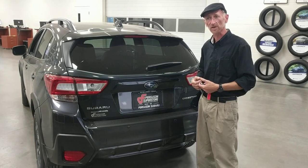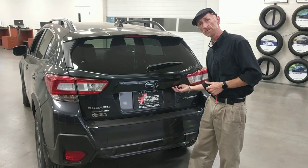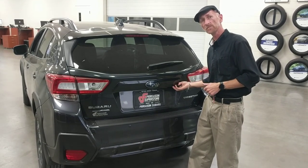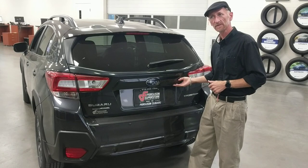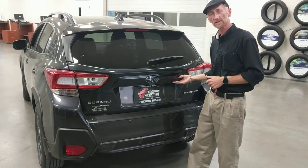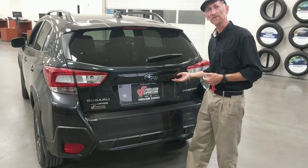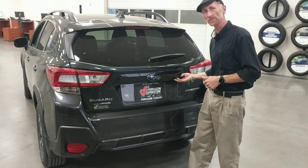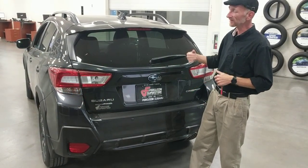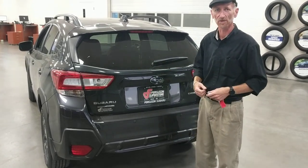It wants us to confirm that number, so we're going to do it one more time: three, one, two, three. There's our chirp. Now two: one, two. There's another chirp. Now for one, now for two — one, two, and three. One, two, three. Now watch — the doors have unlocked, the doors have locked, and that's the car letting me know it's accepted the code.